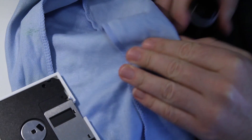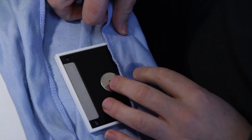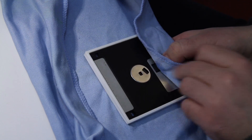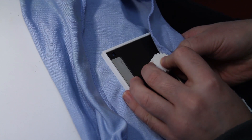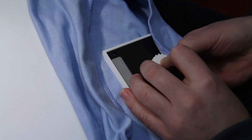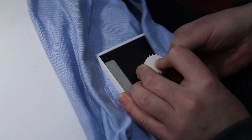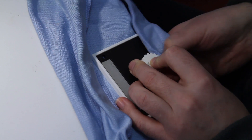I dab a little bit of alcohol on a microfiber cloth. Then I position the disk right on top of the alcohol, making sure that the alcohol is on both sides of a folded piece of microfiber cloth. Then just swipe up and down the disk surface on the edge of the table. While doing that, I turn the donut with the turning knob.